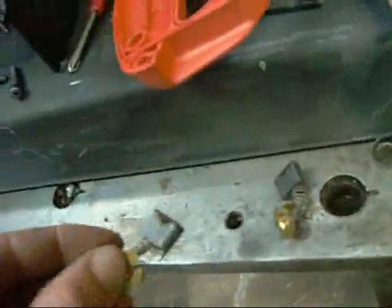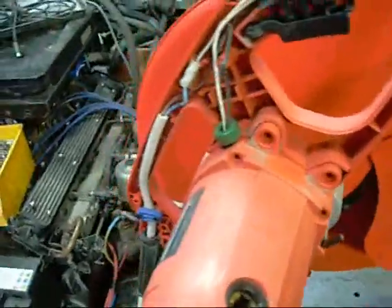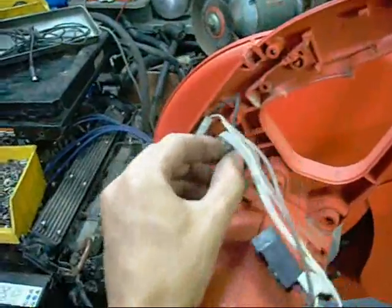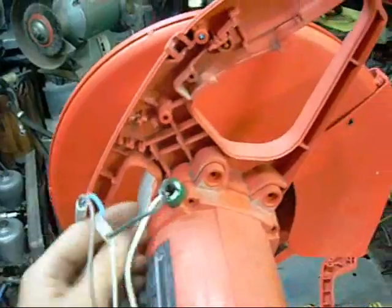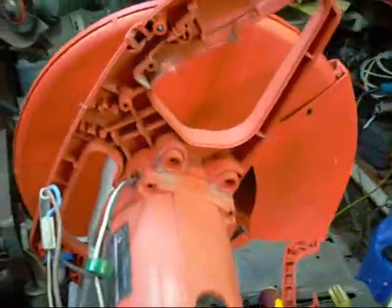Slowly getting it apart. The brushes show signs of arcing and burning, and there are burnt spots on the commutator bars. I just noticed the neutral wire has been pinched against that screw post — it hasn't severed it but it's getting close. I wonder who did that; I don't think this thing has been open since it left the factory. There's a little noise suppression bead on it and a condenser across the switch — not much to them.